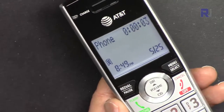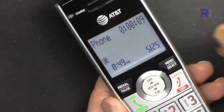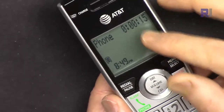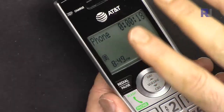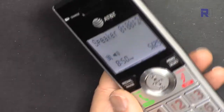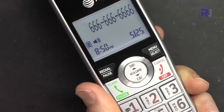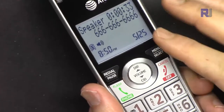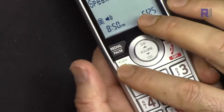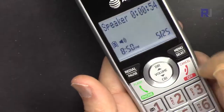While you're on the call, you can hold this person and do conference calling, or bring second or third person depending on the service that you have. In this case, for example, you're on the call with the first person. After connection is established and you're talking, just tell him to wait and press this flash. I'm putting it in speaker so you can hear, and you can dial another number. And once this connection happened, this is the wrong number, but once this happened, just press flash. Once the second call is established, just press flash, and the second call will be connected to the first call.